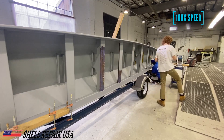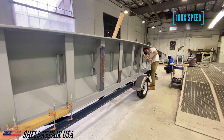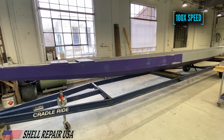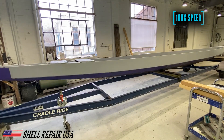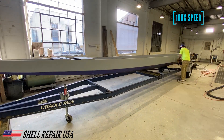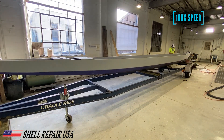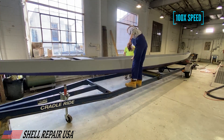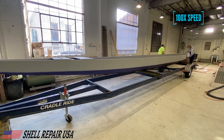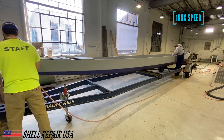You can see we didn't do two of the seats because they need a little bit of repair work. Now we've got the boat back down flat and I'm going to hit this side and the other side once more. Unfortunately, for the paint to stick we do have to go and sand it all down again, so we'll be sanding it down with 180 and then go over the whole thing with scuff pads again to make sure we hit every single surface and it's all ready to accept the paint.